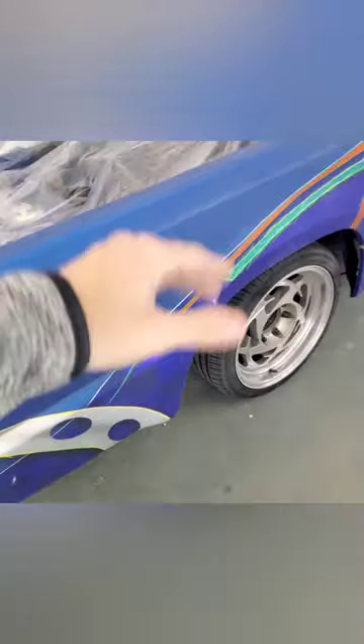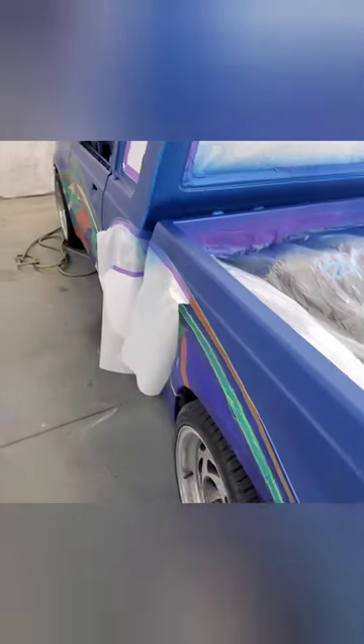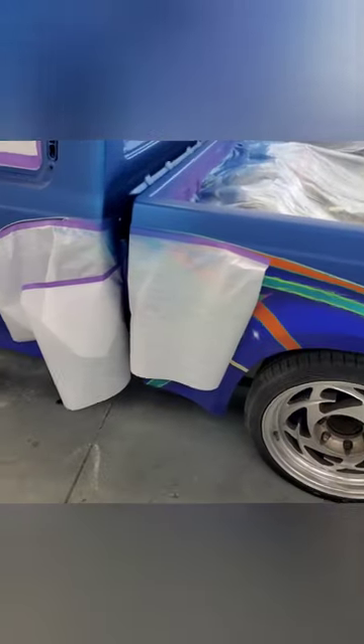Right here is what I'm talking about — you can see a little bit of overspray in the yellow from the blue when doing the insides. It's really hard to tape something like that up. You can either take some thinner and barely wipe it and it'll come off, or you can simply retouch it with some pinstriping and that'll work fine as well. Pick your battles. Everything's blended out really nicely.